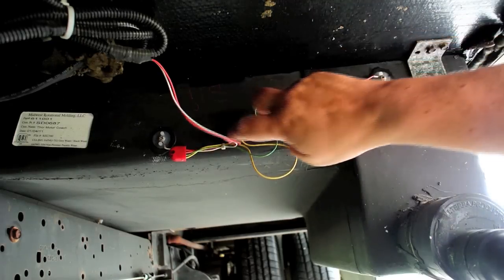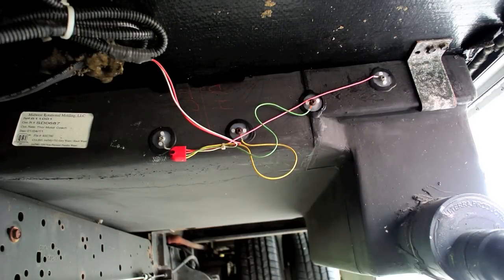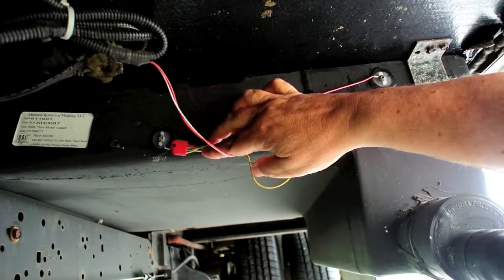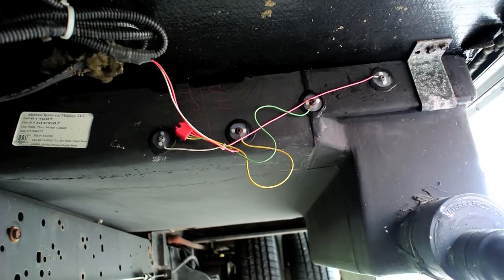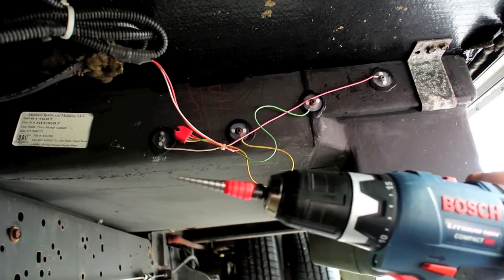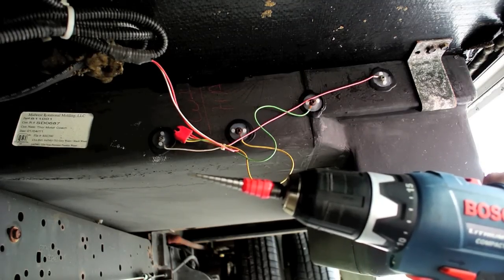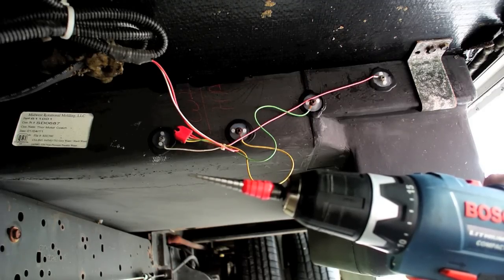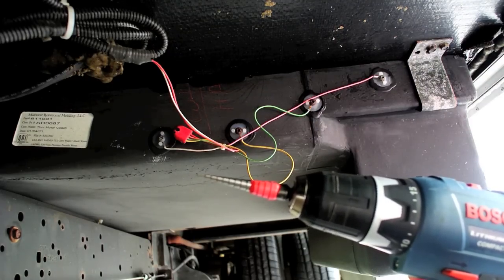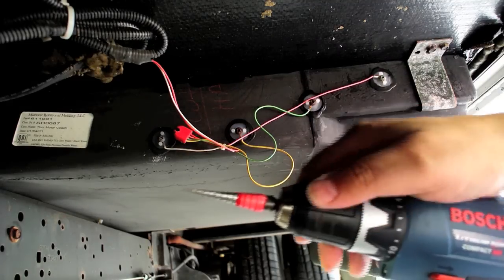Only do one of them at a time, so you don't get the colors mixed up. What I always do when I do a project such as this is take some photographs — if you took all these probes off and needed to find out where they go back, you could at least look at the photograph and find out what the original layout was. When I drill, I'm going to use an Irwin unibit, because I found that in some tough plastic, the unibit creates a very smooth hole, and a standard drill bit really doesn't work very well — it wants to gouge it out. If all you have is a standard drill bit, I'd recommend putting it in reverse, and that might make a smoother cut. But I highly recommend getting some of these unibits.